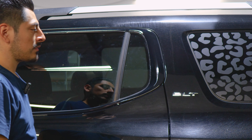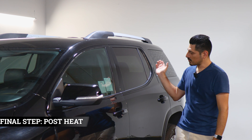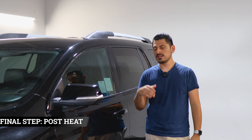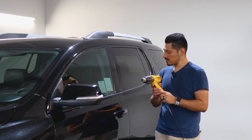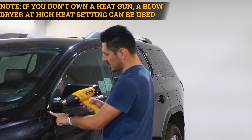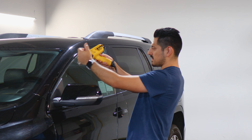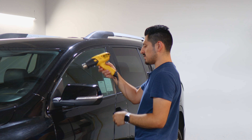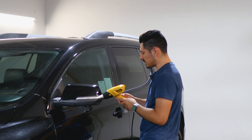And that's it — we're done. The last step is to pulse heat the entire panel and we're good to go. To pulse heat, all you need is your heat gun. Wherever you start, just make sure you apply heat so the adhesive on the film activates faster. If you still see some film lifting, just help it tack down with heat and your squeegee. Once you're done pulse heating each section, you'll be done with the installation.